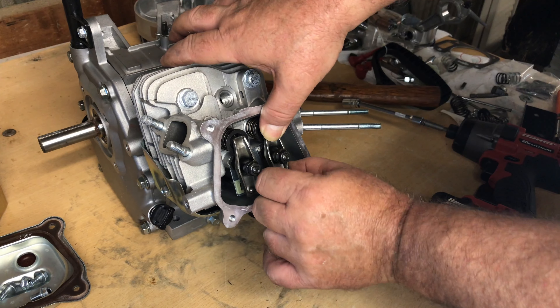With more light on camera — this camshaft measures about 568 thousandths and it does fit the 208cc block, which is what I was concerned about. We have a cam that will work with this block. We can also add some performance rockers. Measuring the crankshaft PTO end, it comes up to 1 inch 179 thousandths — almost 180 thousandths. That's all for part one. We'll get to part two next time — thanks for hanging out, we'll see you next time.